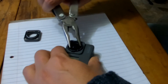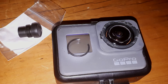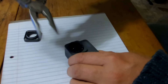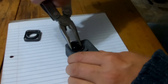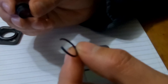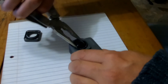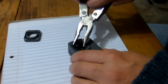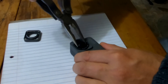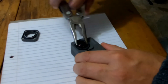Here's where I had a problem. When I was unscrewing, there's a plastic ring at the top of the original lens and it was actually breaking. So I panicked and I thought I'm not going to carry on trying to move the lens. I emailed them and said, here's a picture, I'm breaking this lens. And I got a reply back from Pro Production saying to take your thin pliers, clamp the lens around the edges and turn counterclockwise, making a little bit of effort. So it is quite a bit of effort in unscrewing the old lens, and don't be afraid if the upper edge of the old lens breaks a little.